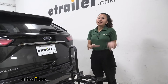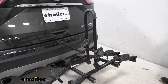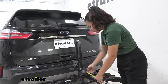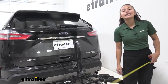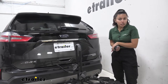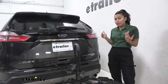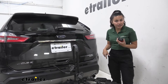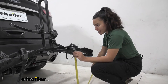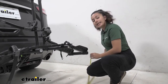Now let's talk about how this fits on our Ford Edge. Whenever you have any hitch accessory, there is going to be some length added to the back of your vehicle. Measuring from our bumper to our reflectors at this end, it's about 23 inches added to our Ford Edge — very compact compared to other two-bike platform racks. If you have a really small garage, this might be a good option if you want to keep your bike rack on in the down position. Ground clearance sits at the center of the bike rack to the ground at 20-1/4 inches, and at the bottom of the wings to the ground it sits at around 15-3/4 inches.